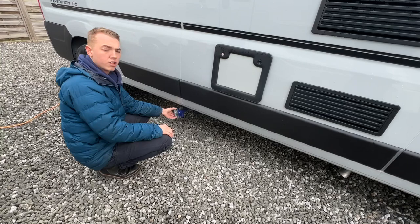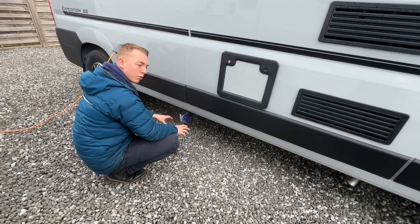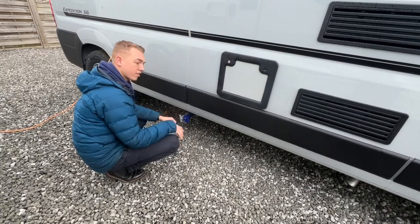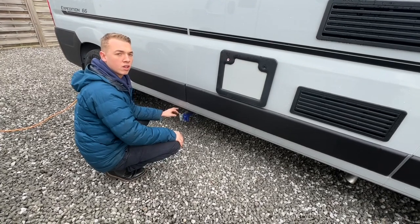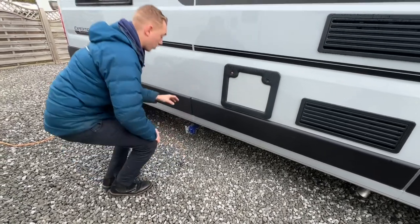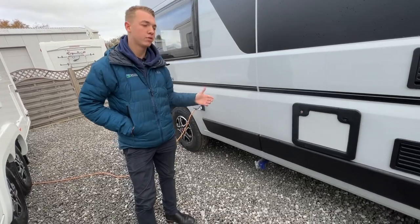On the way out of your site you drive over the motorhome service bay. Some of them have got little pits with grids where you crack the tap open and allow the dirty water to drain, or some want you to drive as close to the hedge or gully as possible and crack the tap open. You always want your dirty water out before you drive off the site, because it adds unnecessary weight that will eat your payload and mean your engine uses more fuel.